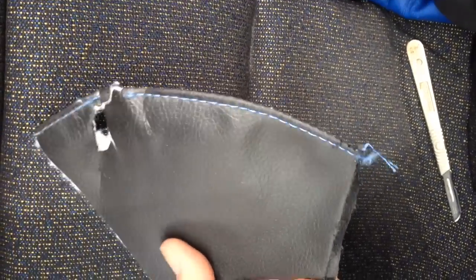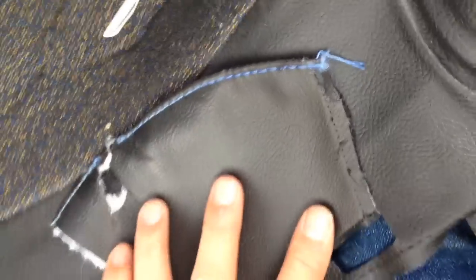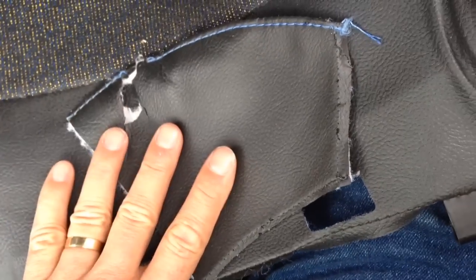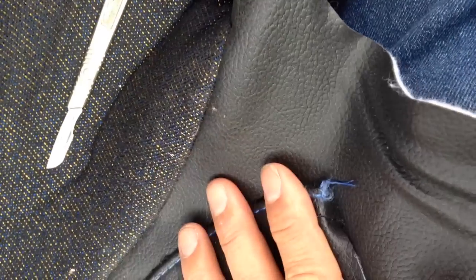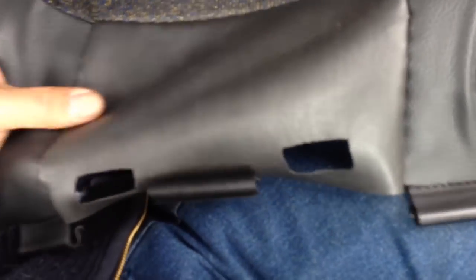This piece is cut out from the side with the hole in it. I'm going to borrow a piece of leather from the other seat bottom — the passenger seat — and that position is just about big enough to cut a piece from. I'm going to do the same thing and replace that with a piece of leatherette on the passenger side as well. That is the replacement leatherette patch put in on the passenger seat. This time I decided just to cut out a patch out of the middle — you don't see it anyhow. And actually the leatherette is a reasonable colour match with the original leather.